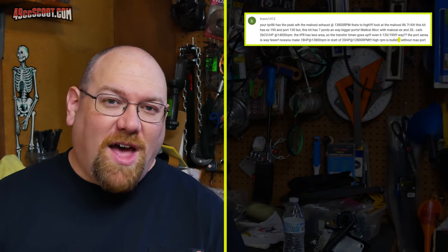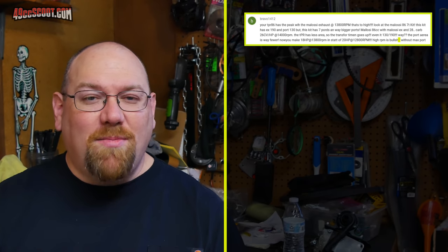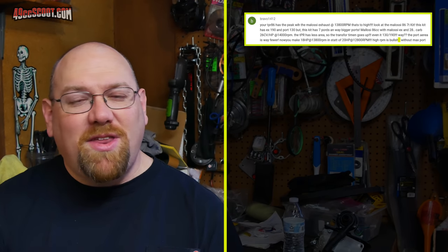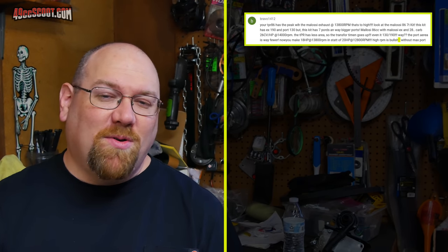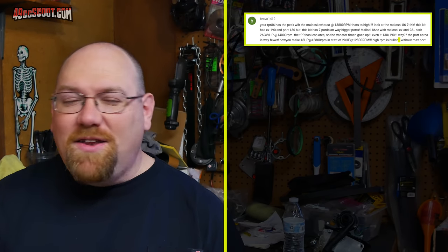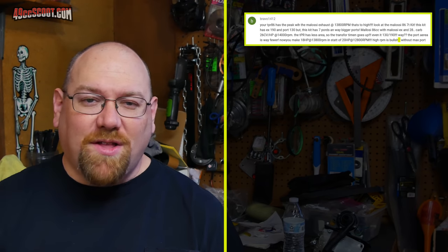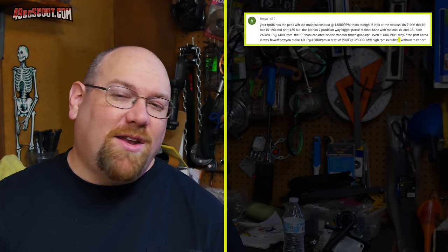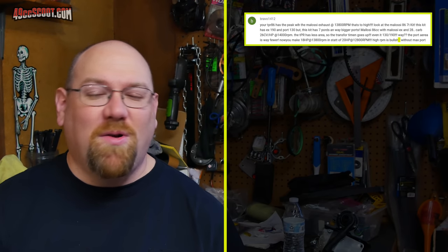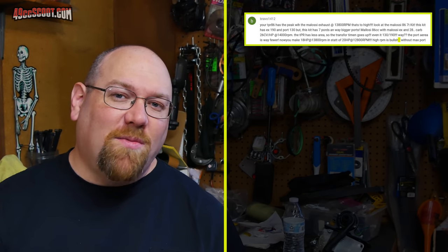Now, this is kind of off topic, but I just wanted to address this while I'm at it because it's something that I've heard so many times in so many of my video comments. A lot of people believe that they know what's best for this, and I absolutely am over revving it all the time. I need to try heavier roller weights or sliders. I need to use a softer contra spring. Whatever the case may be, I just need to get that RPM down. People have different numbers, but it usually tends to be around 12 to 13,000 RPM.